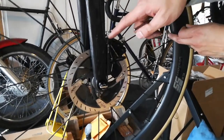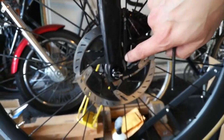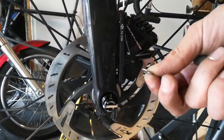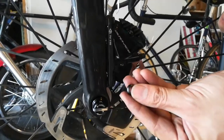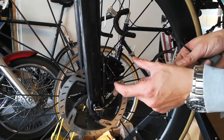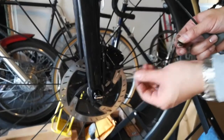The way I did that here — and I've already done it — is I've added these spacers or shims to the calipers underneath the mount, right there and there. You could use an actual washer like this, which is pretty thin, or if you need a little more space, you can use a larger spacer like this. Once you move the caliper out on the rotor, that noise will go away. Try with a small spacer or small washer first.